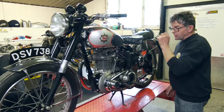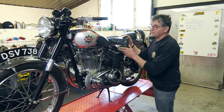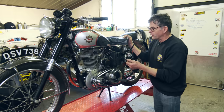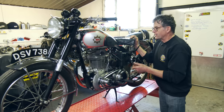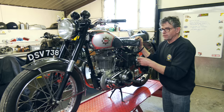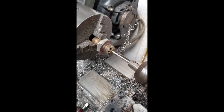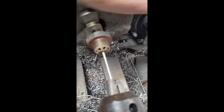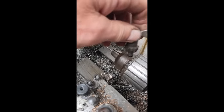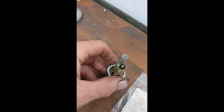We recently recommissioned this. It came in with a dual seat and a concentric carburettor — a modern carburettor. I said to the customer, Phil, let's put on the TT carb. It had some issues with the carb; whoever worked on it couldn't get it to run right. We centred the needle — done that in the lathe. Put it in the chuck, made sure we got a nice taper in the centre and a nice finish. There's a little video of that somewhere. It doesn't drip now and will idle pretty well on that carburettor.